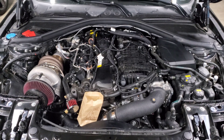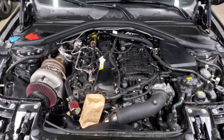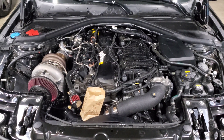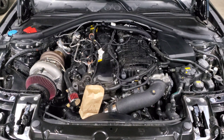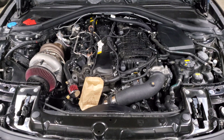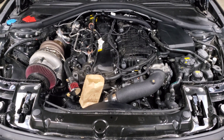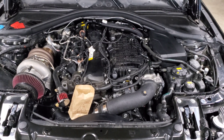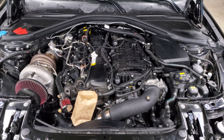A lot of people do this for simplicity — if you already have an intake and an aftermarket downpipe, you can swap your turbo and reinstall all those parts and it will fit just like before. From a reliability perspective, hybrids have generally been pretty reliable, even from companies people had concerns with from the N54 days. Keep in mind any turbo can fail — I've seen failures including damaged wheels, oil leaks, and damaged wastegates — so make sure you're buying from a company you trust, so even if you're in that one percent, you'll be covered.